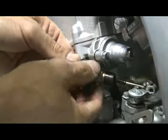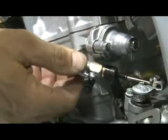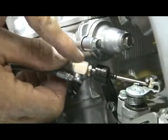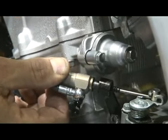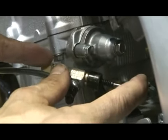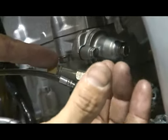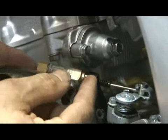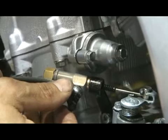You'll want to check a couple of things. Check your free play — basically by pulling the slave out as far as it will go, you should have three to five millimeters of free play. This one is at about five millimeters, which is on the extreme end. Anywhere in that range allows the system to operate and deal with your heat and expanding clutch plates, repositioning the piston so that heat-affected positioning can adjust and not affect where your engagement point is on your master cylinder.